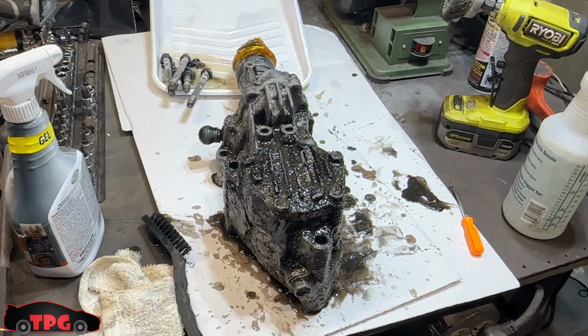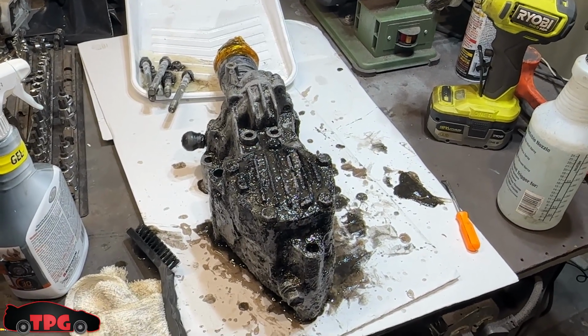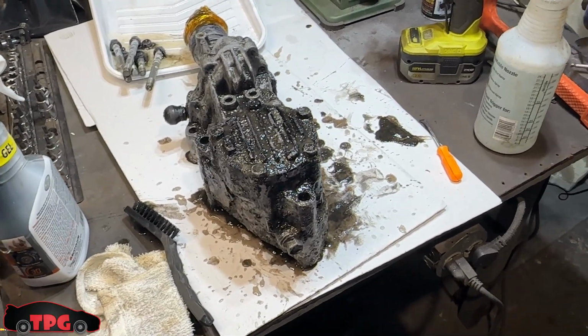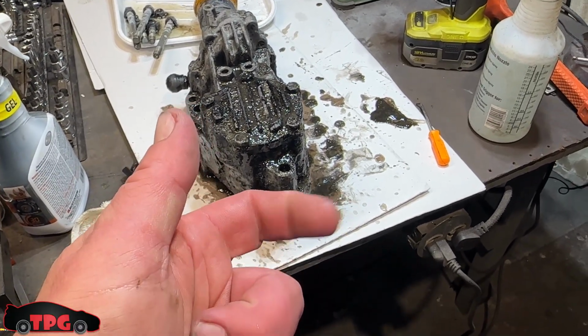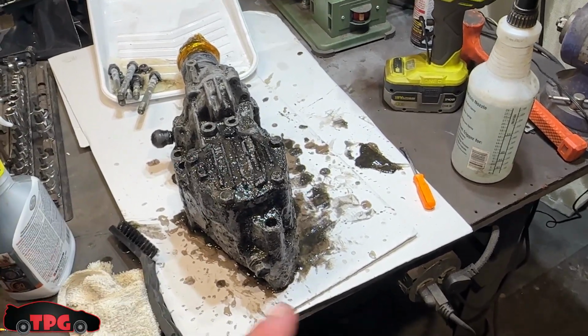I have to pull the gasket out for that, and I have to spray some penetrating oil on all those little 10mm bolts because we don't want to be breaking bolts. Also, if you're going to swap your oil pan out and you're pulling those bolts and they're a little crusty and rusty, hit them with penetrant a couple of days ahead, and then before you start pulling them out, get one of those little mini torches, and you can heat those bolts up, or just the circumference of the pan before you drop it off.